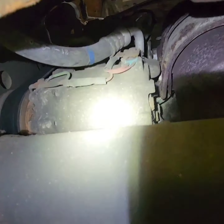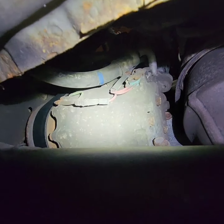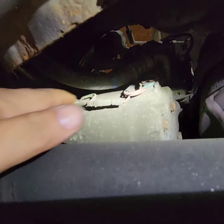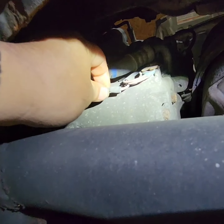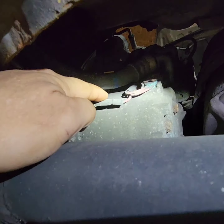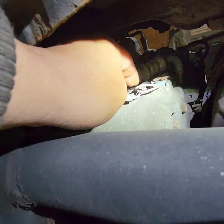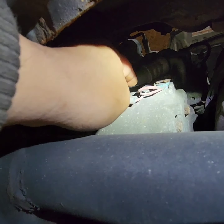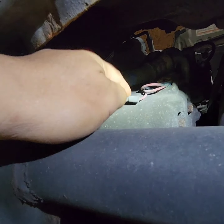All right, we are under the car. As you can see, we are looking at the AC compressor, and I'm interested in what they call a thermal switch, which is located here. So this line here is your positive, and this line here goes to your relay and fuses. So from relay to fuses, it goes here and then continues to connect into this line,